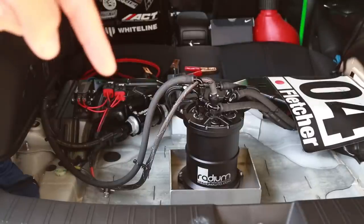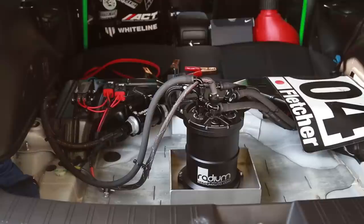There are two relays — pump one and pump two — so when I hit a certain amount of boost, around six pounds, pump two switches on, which cycles the fuel from the surge tank and makes sure the car's running well. Before I got the surge tank and was running 460, we had an issue where the car wasn't getting enough fuel. I also wanted to minimize fuel slosh and fuel cuts when tracking, so with the surge tank, you're set. This surge tank setup will support north of 600 horsepower if I ever want to go for that. That basically covers fuel.